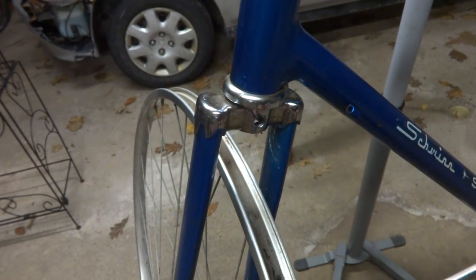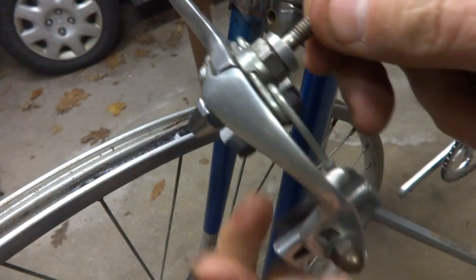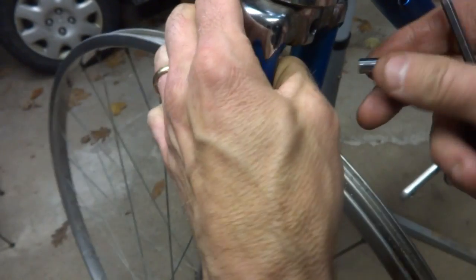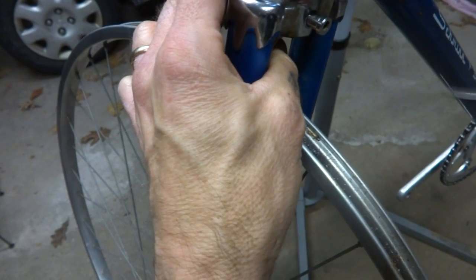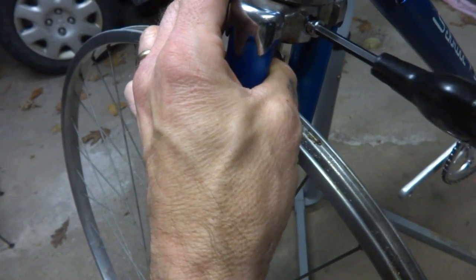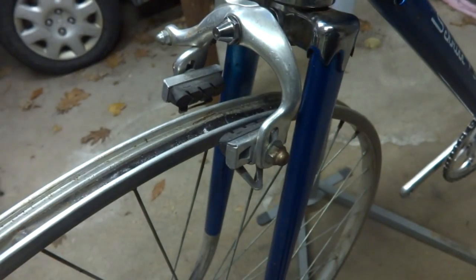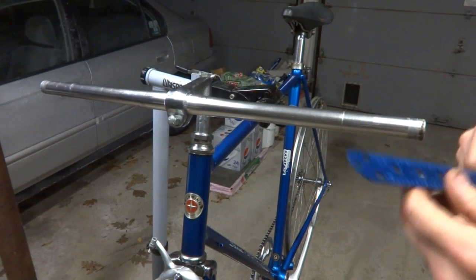Okay, so I'm through. Make sure the nut fits, and the little nut does fit through there. Excellent. Now I can mount the brake on the front of the fork. I'm using a concave washer to match the curvature of the front of the fork. Then turn this around, get the bolt lined up with the hole, insert this nut into there, and then I can screw this on with an Allen wrench. And there. I may still need to adjust the brake, but it's mounted on there like that.